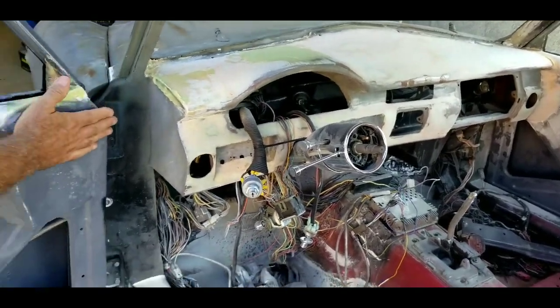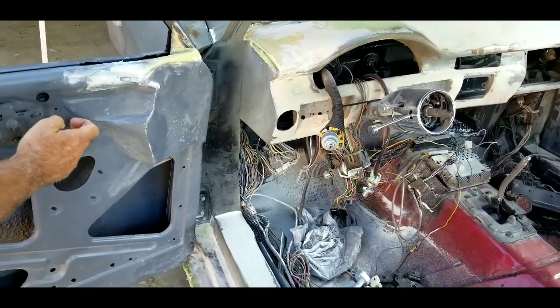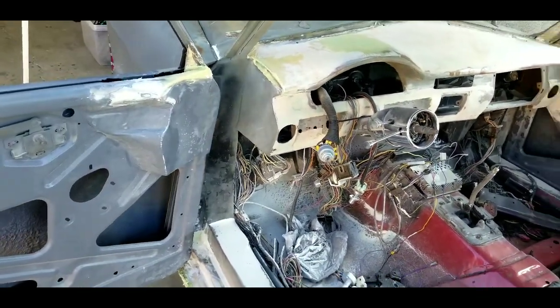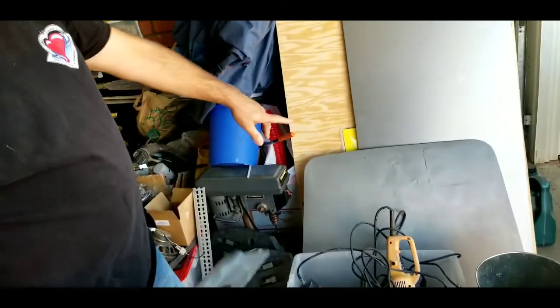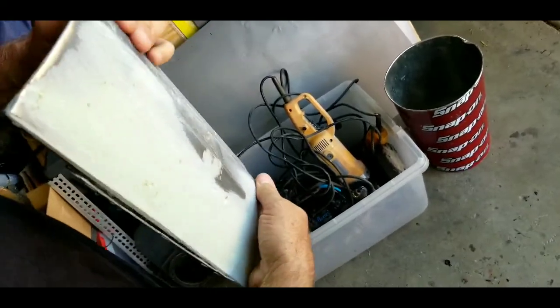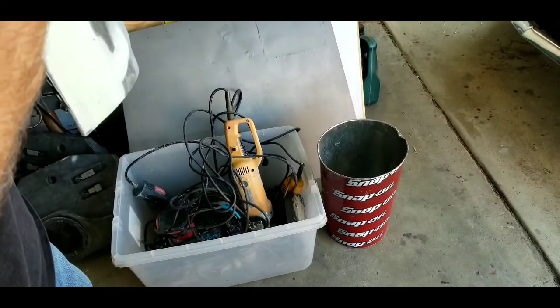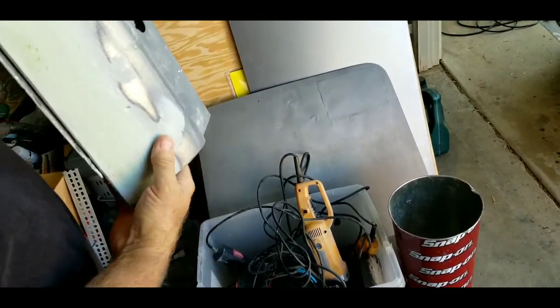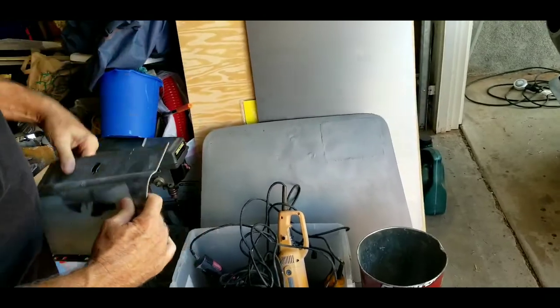I put the ears off of the dash onto the doors, so I have that neat little look on it. And then I sandblasted the trunk — obviously I got a few pinholes to weld up. And then I redid the glove box door; this is off a 58 Ford. I had to add a piece of metal here and then blend it all. So I got a little low spot here to deal with, but other than that it looks pretty good.